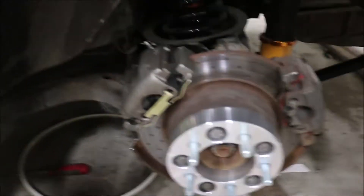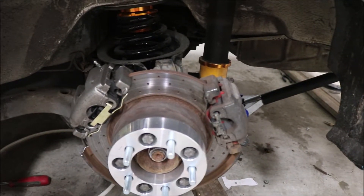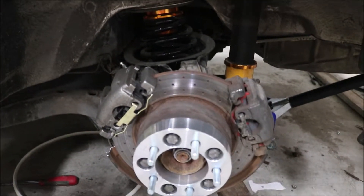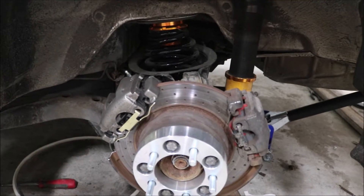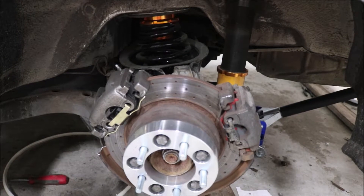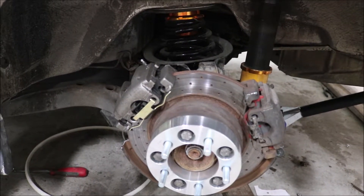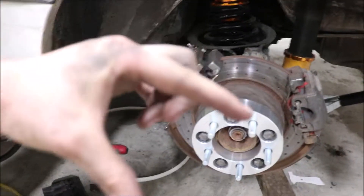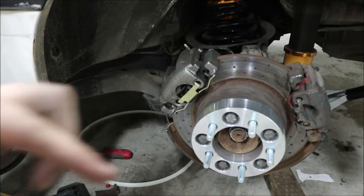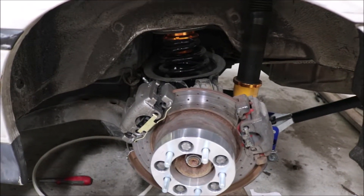We have the dual caliper bracket installed. It's a bracket from SRS Performance — it is a weld-on bracket, not a bolt-on like the 240 that the Villains provide. You have to get a stock E36 caliper, brake lines, and a hydro, and that's it: hydro, brake lines, brake pads, calipers, and the tabs to weld on — and you're done. I got the V2 because the V2 was a solid piece; the V1 is just little tabs you weld on individually. This way I could get the exact distance so I knew the caliper would bolt up.